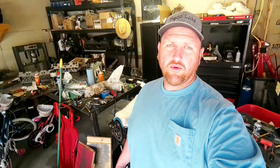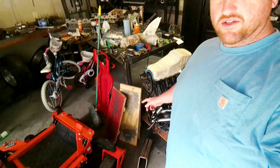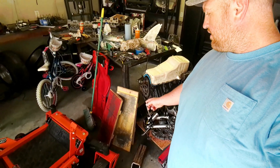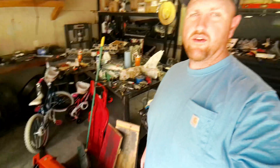Just a heads up — we lost some of the footage from actually resurfacing the deck on the block. What I did was take these three boards I made up and put 80, 120, and 320 grit on them, then ran them back and forth across the surface, keeping checking with the feeler gauges to make sure we were right around two-thousandths — we didn't want the gauge to slip under. So we're pretty flat there, unfortunately I lost a lot of that footage.